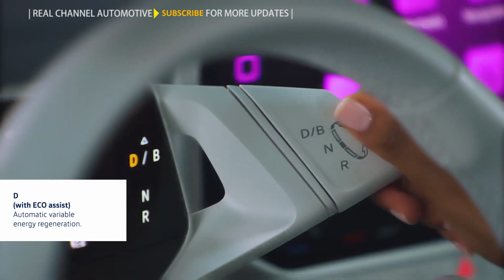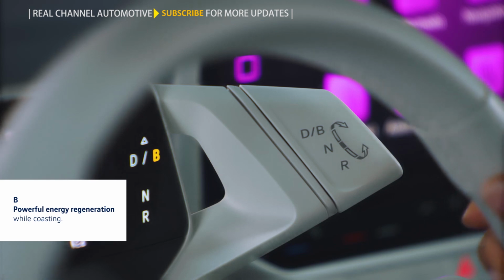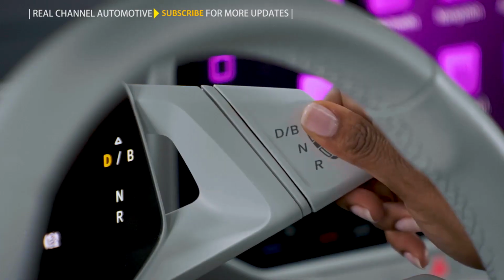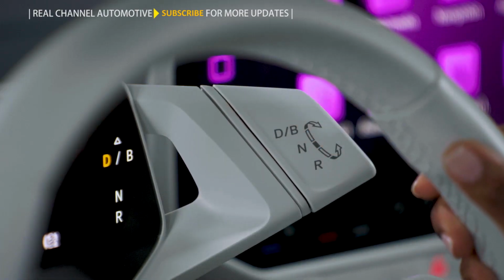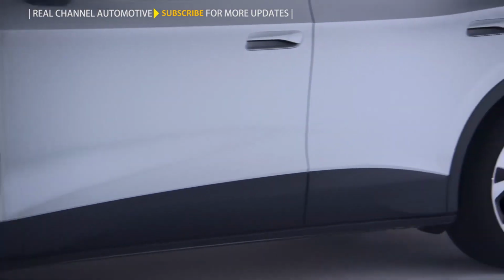Turning the selector again toggles to the B or braking setting, which engages powerful energy regeneration while coasting. This helps recharge the battery while driving. To revert to D, toggle the drive selector clockwise again. Press the accelerator and you're off and running.